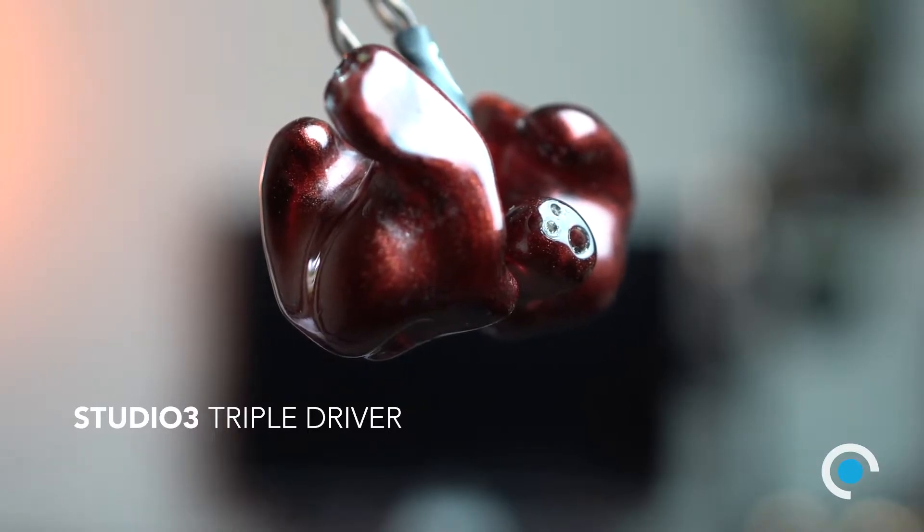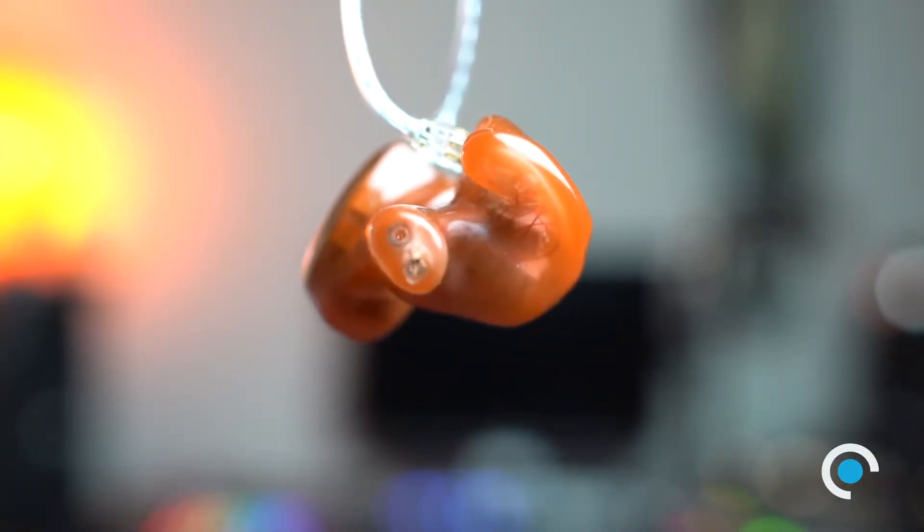Why are the bores important? When your driver is connected to a tube that comes out of a port and goes into your ear canal hitting your eardrum, the RSM has two bores, which means those four drivers are combining into a tube — so there's going to be some mixing happening in the tube which can cause some distortion or turbulence. You don't really hear it as distortion, but you'd hear it as a subtle lack of clarity. When we move to three ports for a three-driver, you're getting all the clarity you need because the sound is mixing in your ear canal, not in the tubes.